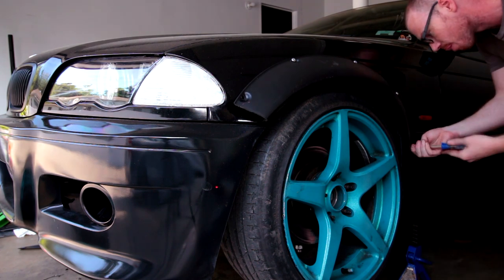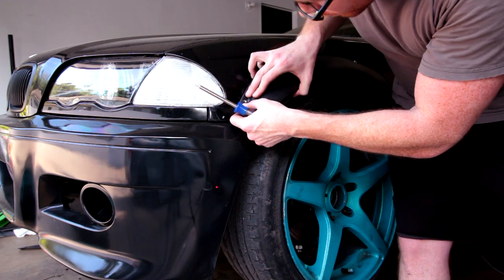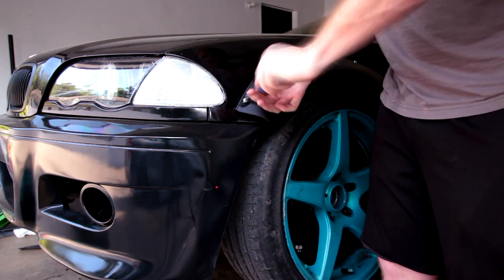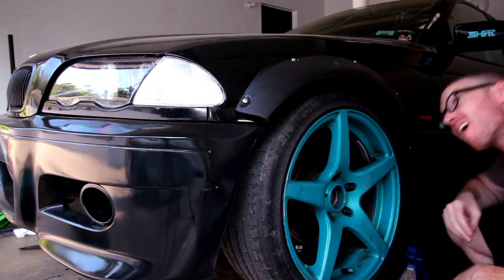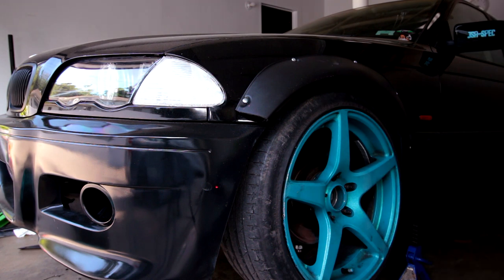What worked best was to mock up the flare so the opening of the fender flare was parallel in height to the stock fender opening. That lined it up with a body line on the stock fender so the flare wouldn't interfere. These are generic flares — quite rigid and made of cheap plastic — but that's what I ended up doing. Once you do one fender it can take a long time, but after that it's a piece of cake. Congratulations — once you've rib-nutted your stock fender you're halfway through the painful bit.